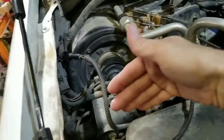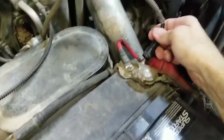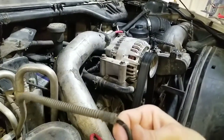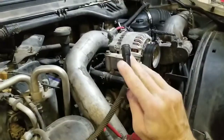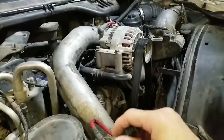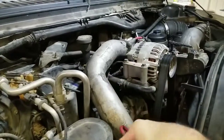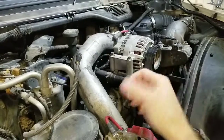The easiest thing to do is come over here and pull this plug that's on the passenger side right by the fan — pull this plug out just like that — and connect it to the positive cable like this. This goes to the starter, so you'll be able to do a quick check just like that to see if the starter is actually bad or if it's in the ignition key or whatever diagnosis you're doing. You can also do a compression check this way: put your compression gauge in the glow plug hole, then come up and just touch that right there, and you'll be able to see the compression reading right away.